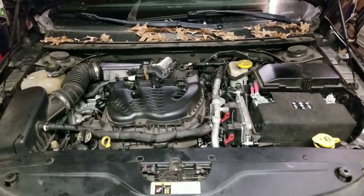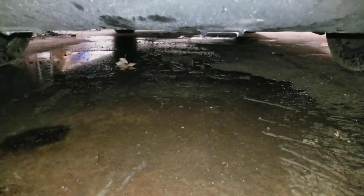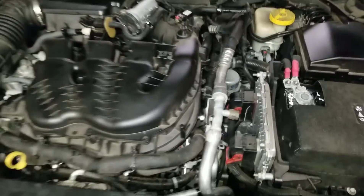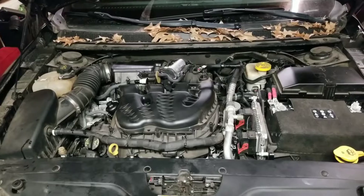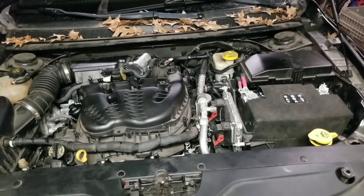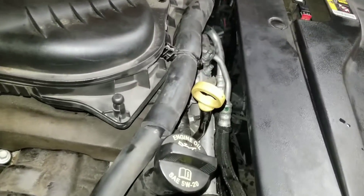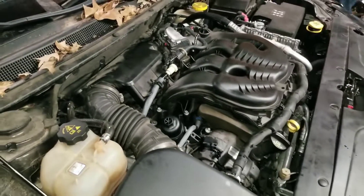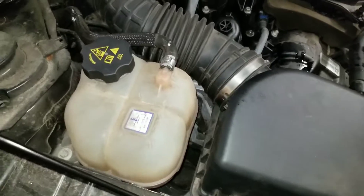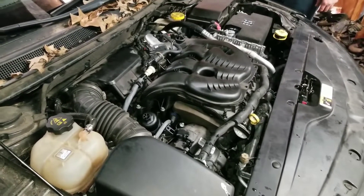Usually that's the problem if these are leaking oil. We did change the oil and we're going to put a little more coolant in it — then they should be ready to go. It took about an hour and a half, even messing around most of the time. It's your oil cooler if it's leaking — you're going to need coolant, Dex Cool in these, and you're going to need an oil change at the end of it. We'll see you in the next video.